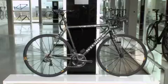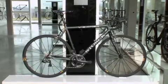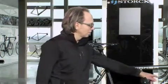So our Scenario Pro was holding the record for several years in Tour magazine, and when we started to develop the Visioner, we had in mind to bring new properties to aluminium frames. And so we started to develop a frame which is also for mechanical and electronic wiring and cable routing, which you see specifically here. In addition to that, we wanted to make the frames that it works with PressFit crank arms and bottom brackets. So we have the 86 Shimano standard for the bottom bracket.